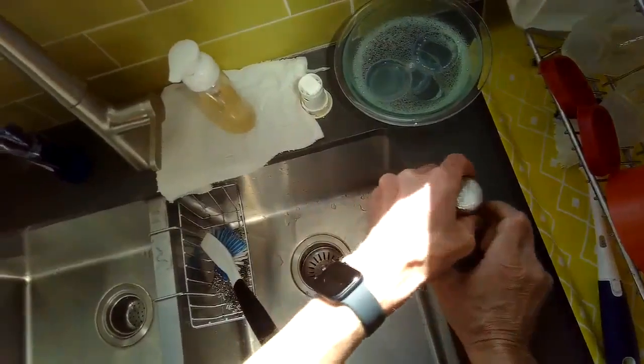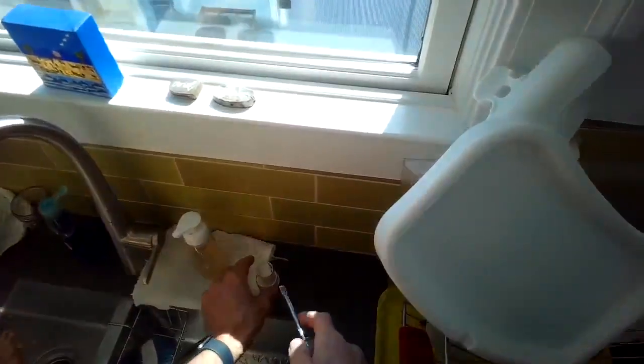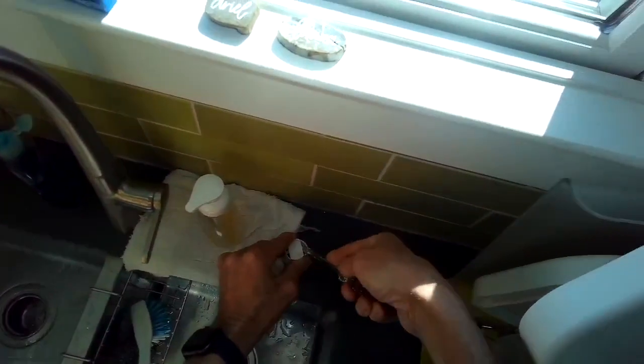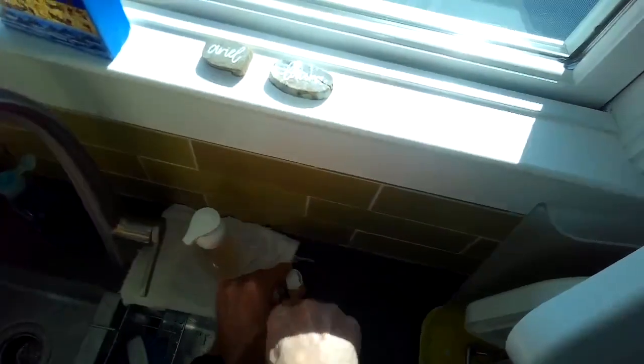So I'm going to do a little work here on this air gap. I pulled off the silver piece here, and then I'm going to pull off this white piece by prying in with a standard head screwdriver on the two plastic tabs, and then I can lift it right off. Just take your time here to be able to pry off that plastic piece. On some air gaps you actually unscrew that white plastic piece. And most of them though you have to kind of pry it off.